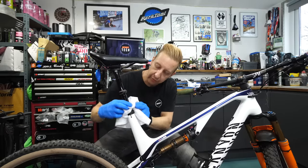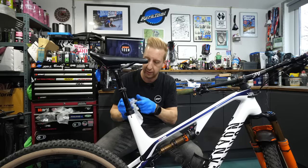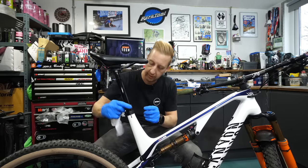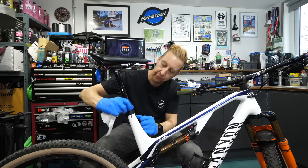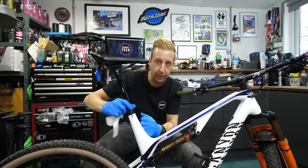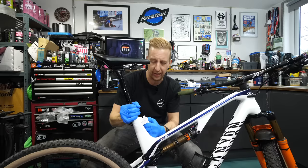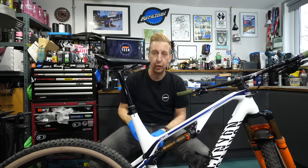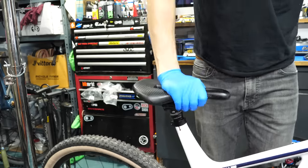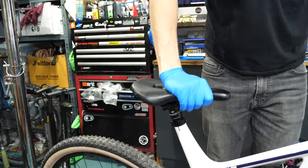Just make sure that anything drawn out is wiped away. Put a bit more oil on there, screw down the seal head — only needs to be hand tight. A pair of rubber gloves like these will give you a good enough grip on there. You don't need to crank it up. Good for action, and it's going to be much smoother and faster if it was a bit of a slow post to start with. Job done.